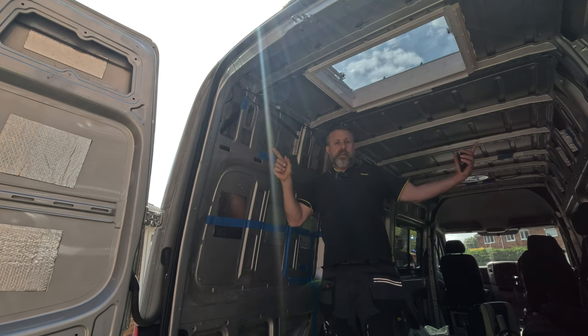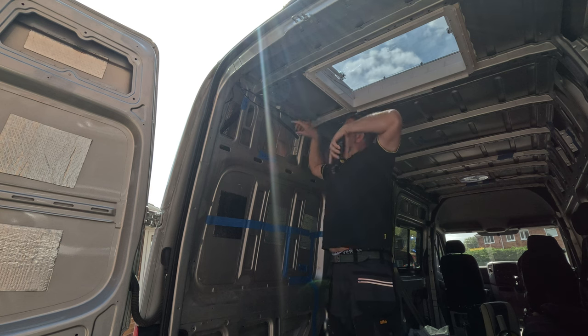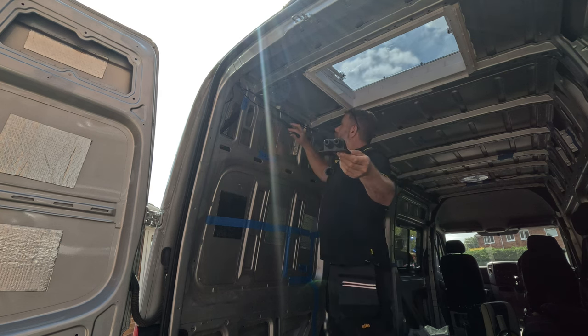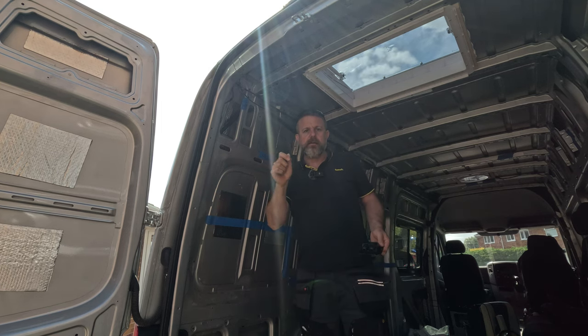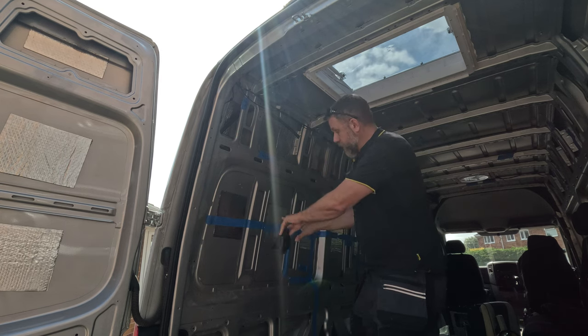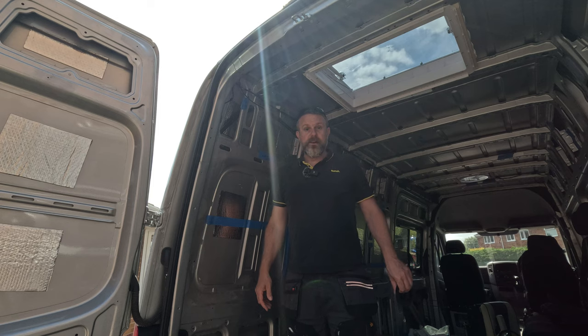The other positive and negative from the solar panels will come along the roof, down through this gland, through the hole, into the conduit, and it'll poke out down here. Well, it'll be labelled positive and negative for future when I get round to building the electrics, which is going to be here on a big board. So let's make a hole, shall we?